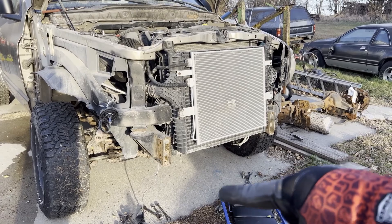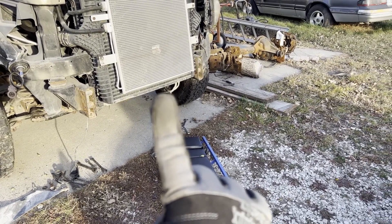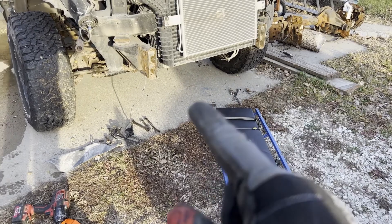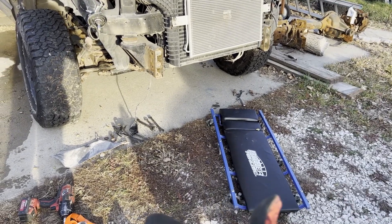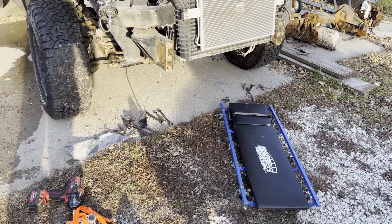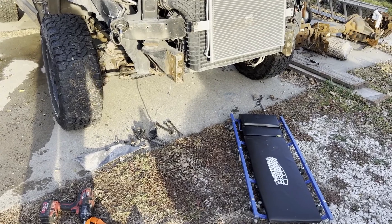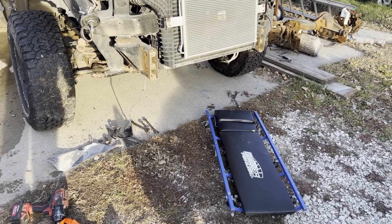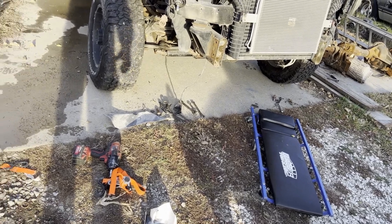There's a little droplet of power steering fluid here. These hoses look like a clamp is bad or the hose has deteriorated enough to start leaking. I did have to replace the steering gearbox because the accident actually snapped the end of the gearbox completely off — the part that connects to the drag link. You could sit in the driver's seat and spin the wheel and nothing would happen. I may have damaged the lines, or they might just be old enough that they're leaking — I'll need to tighten the clamp after everything's buttoned up.